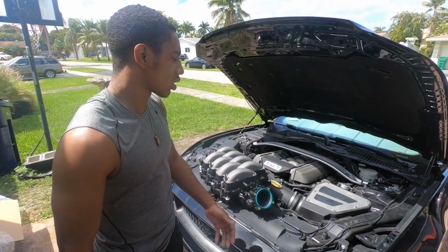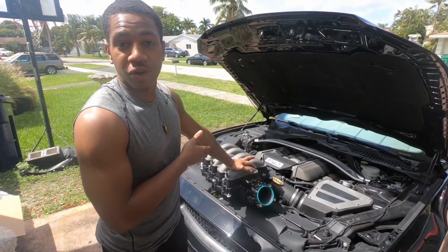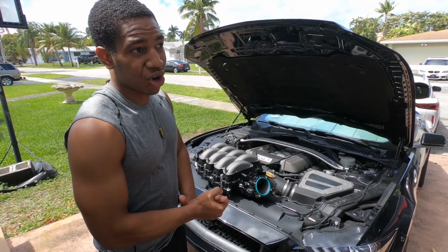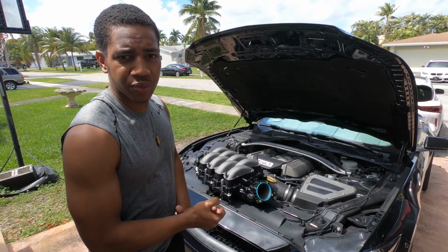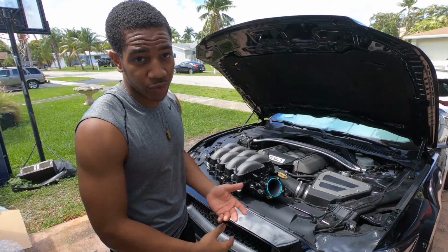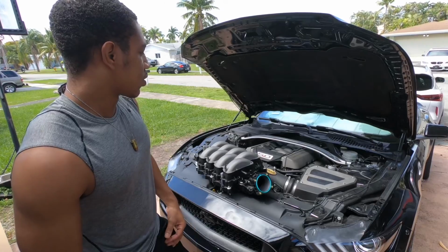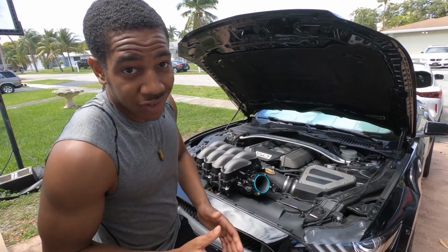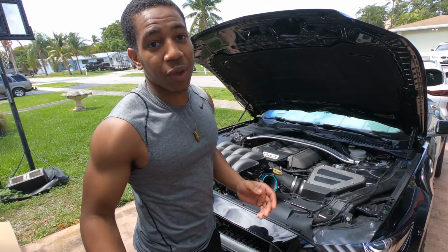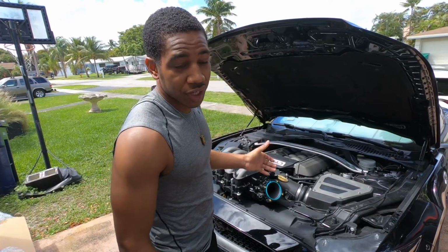I'll probably be shifting at about 8,000. To accompany this today, we are throwing on some 47-pound injectors. They are about 493.5 cc, if I'm not mistaken, for those of you who go by cc. The stock injectors are 34 pounds an hour, and I think that's about 357 cc, so it's a pretty substantial gain. Disclaimer, for those of you who think injectors do not give you power: they just allow you to make more because you can inject more fuel. In this case, we need it because we are going on a flex fuel tune.